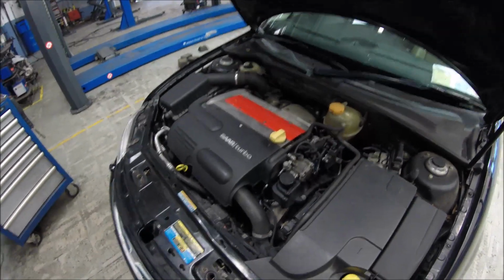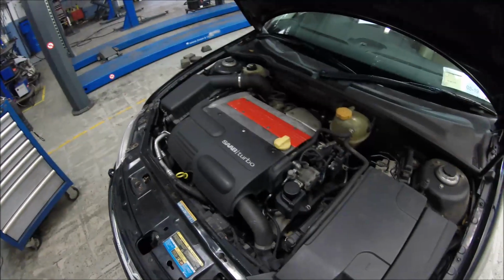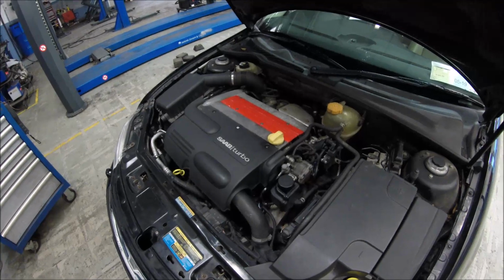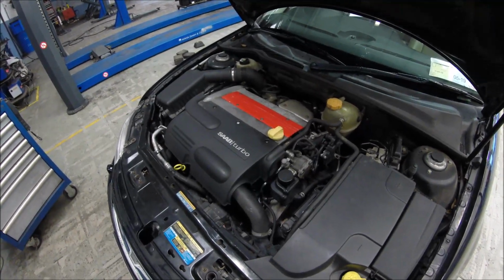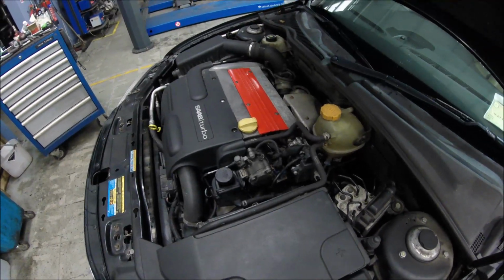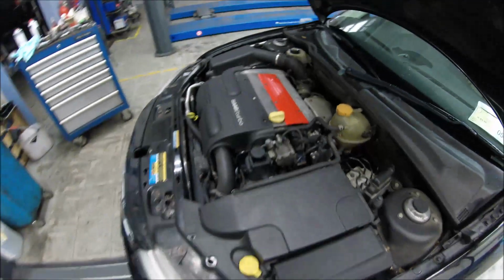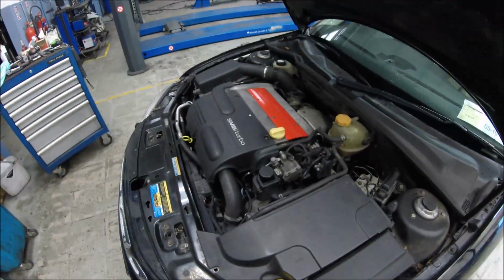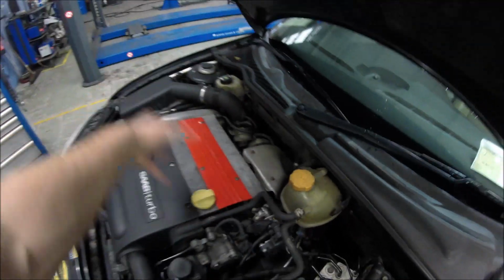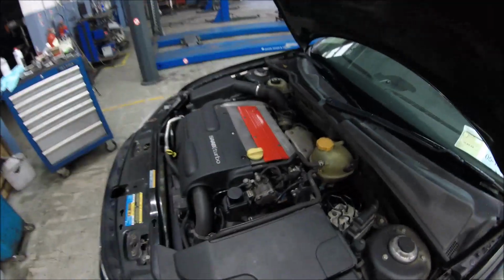The car almost passed emission when it's warm, 100% passed the emission test. So I hope it's the rubbers that are the oil source. Hopefully it will be nothing bigger. All right, it's still a little bit hot, but I haven't time to wait. So okay, first remove the one cover, second cover, plug coil out, and next step the rocker cover.